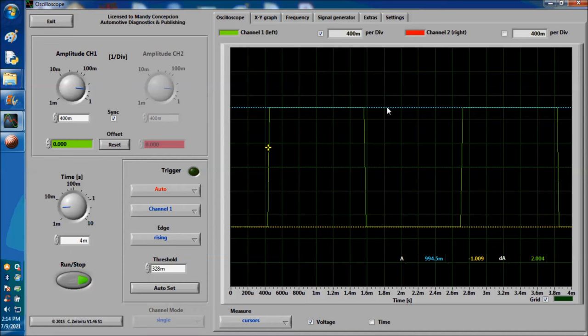But anyhow, again, make sure that the gap between the upper side and the upper part of the waveform is not too great. Now, for the ground, as you can see on screen, this has to be 100% on the money. There's no 100 millivolts in there. You cannot forget it. It has to be grounded properly. Maybe 10 or 20 millivolts is fine, but for signals, everybody has to be grounded. Everybody has to be on the same.